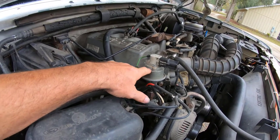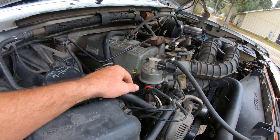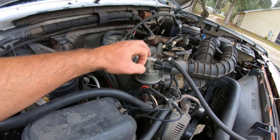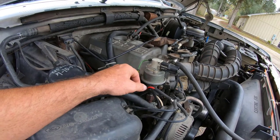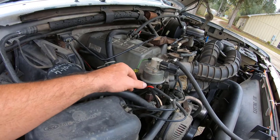I had two codes: EGR and a wheel speed sensor. Well, odds are a wheel speed sensor is not going to be tied to an exhaust gas recirculation valve — not saying that it can't, but it ain't real strong odds.